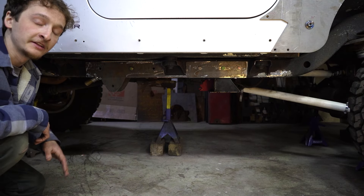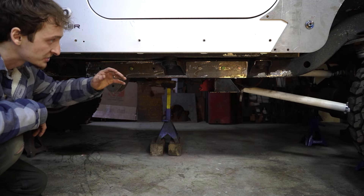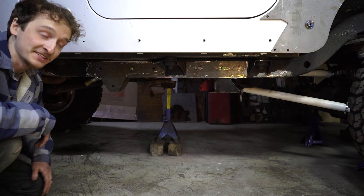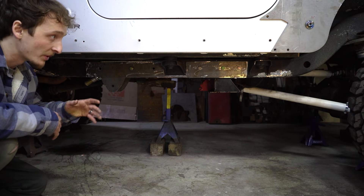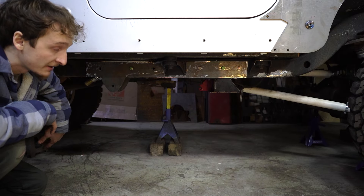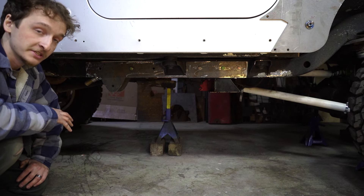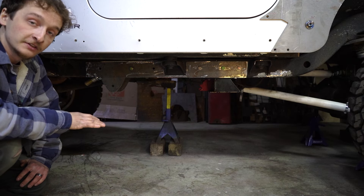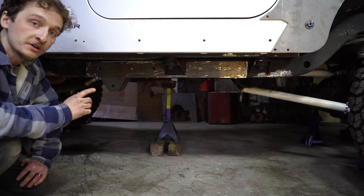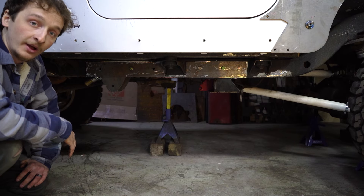After finishing the bumper and rear armor, we moved on to the suspension. We ripped out absolutely everything from underneath this Jeep — short arms, brackets, skid plates, drivelines, axles, absolutely everything — because we're doing a lot of work under here. Once we had a clean slate, we started fabricating our own suspension. The front suspension is a three-link long arm setup: two lowers and one upper, completely untriangulated, with a custom track bar as well — basically the go-to suspension for these Jeeps.